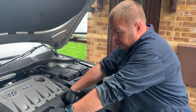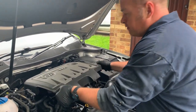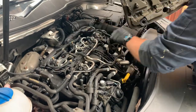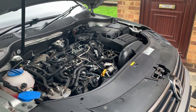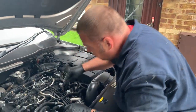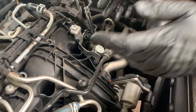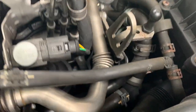The oil filter lives just under here, under this engine cover. These just simply pop off — we've got four rubber bungs that locate onto these little ball joints, for lack of a better word. So that comes off. What I've done in the past is take this bracket off and undo these two pipes here — that gives you plenty of room to get that oil filter out. Although it looks pretty tight, it does give you enough room. Whilst you're draining the oil, you can just knock out your dipstick tube slightly to allow the air in, or even undo the oil filler cap.